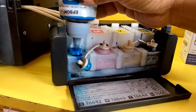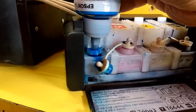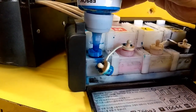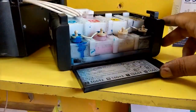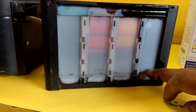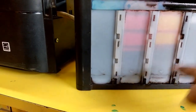Fill all colors into the ink tank with the proper color. As I said, don't get confused and don't fill the ink in the wrong bottle, or your printer will have a serious problem. Now just attach the cap. Every ink tank printer has a low ink indication — you need to refill the ink when it's below the low indication.